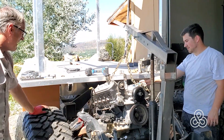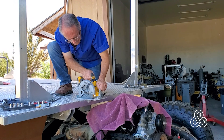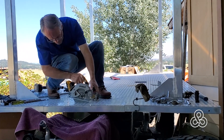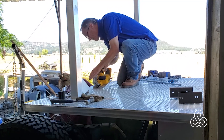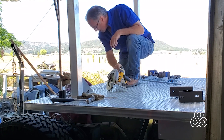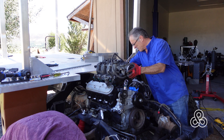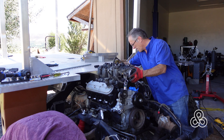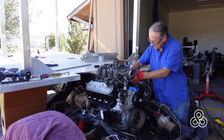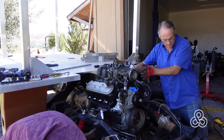Once we've got that engine in it's time to start assembling some things, but we found that there's a little bit of a clearance problem. I was kind of expecting this but didn't want to try to cut this notch originally until we had the engine in place and knew exactly where to go. We have to cut a little section out of the floor, but that's okay — we have bracing in place to support it around that. With that notch out of the way, the intake manifold, which was the big clearance problem, fits fine.